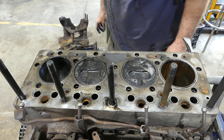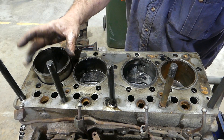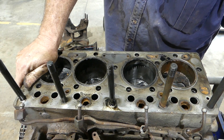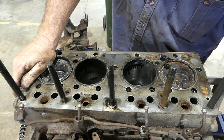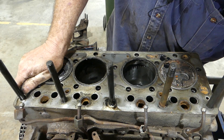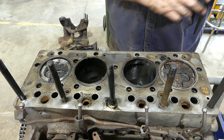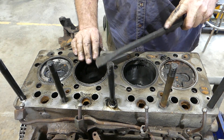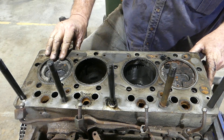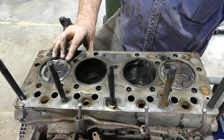So the gasket looks good — it didn't have a blown head gasket, but it had a tight valve. Now when we turn the engine over, it is common on these 23C engines that the liners are the loosest, sloppiest fit — I don't know why they have to be like that, but they are. They're dry liners too, so you haven't got the worry you have with petrol engines of the liners lifting and the gasket around the bottom running up on you.